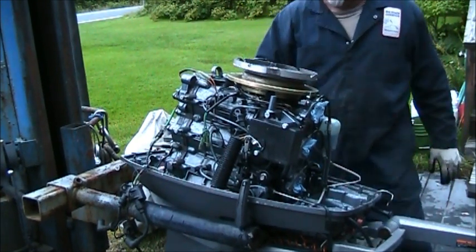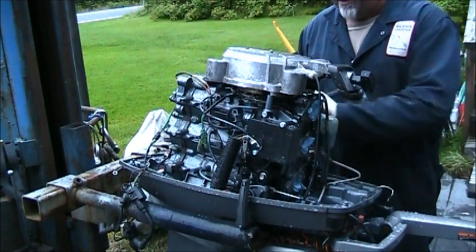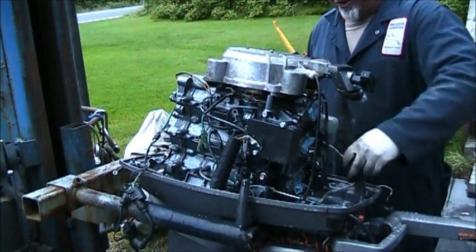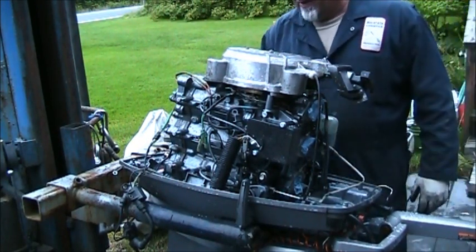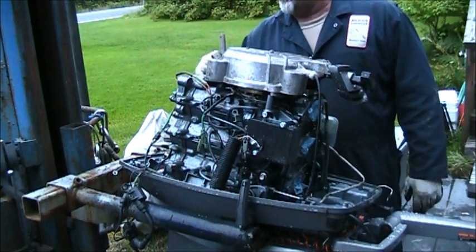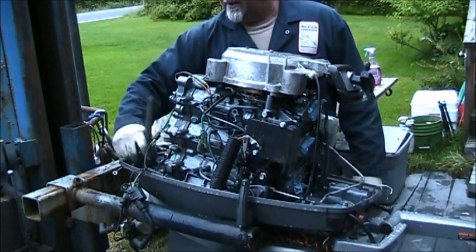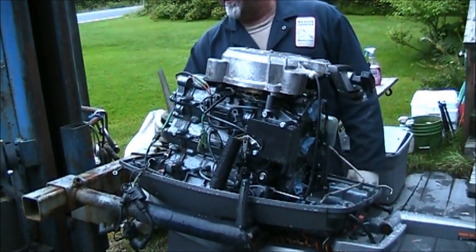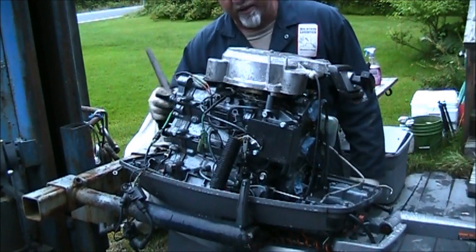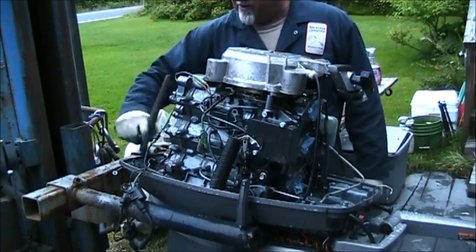So we used the gas to cut the grease, the dirty, thick grease mixed with salt, grit, everything else. That's what the gas was for, to thin out all that petroleum that was caked on here. Then we come behind it with the purple power, and that breaks it down even further into a soapy slather emulsion. Then we'll come by with a little bit of water. I said little bit now. You ain't gonna throw this thing over Niagara Falls. You're just gonna give it a little misting. You understand? So we got her all slathered and slurried.